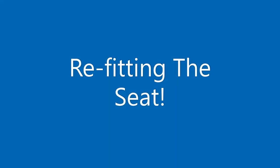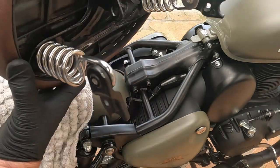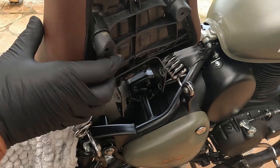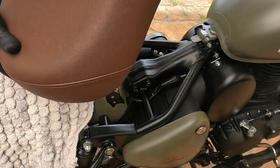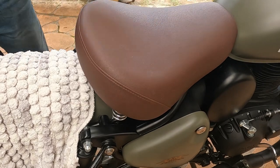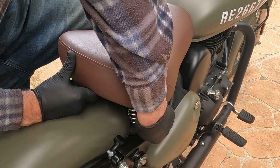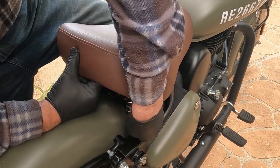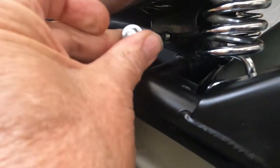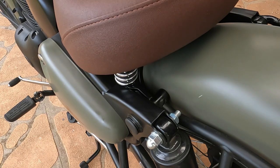First thing is to protect your rear guard in case anything goes wrong. We've now got the seat here — from underneath, the springs are hanging loose. Up the top part there's a recess where we've got to get the tongue from the seat into it. Drop this down into the hole, lean back a bit — I've got the seat locked in position. Come around here, lift the seat up and bring it into position. Put your cross bolt in for the seat, which locks it in position. Then the bolt goes into the framework — put a washer on it and bring the bolt in.